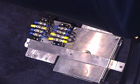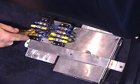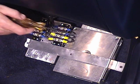Now the other wire that we want to check is the trigger wire. Remember, this is the one that's coming from the PCM pin number 22. Same wire that's going to that self-test connector. When that one grounds with the key on, it makes the pump come on. So I'll turn the key on and then probe that connection with the test light. It will ground it. That's this location, and you may be able to hear the pump came on. Undo it, pump went off.